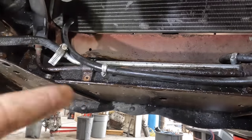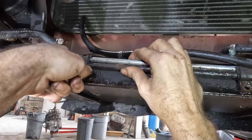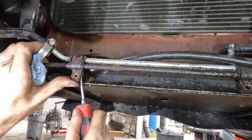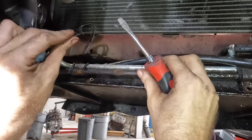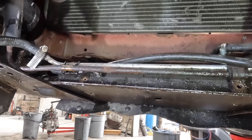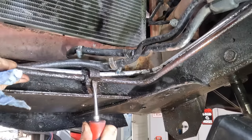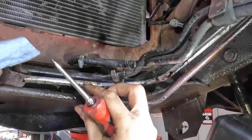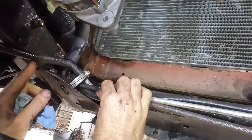Good thing I have all those spare bolts from the Miata. Now that the bracket bolts are out, let's separate these mounts and peel this line out of here. I might need a screwdriver — a pry driver. This is just a metal strap that wraps around these lines with a rubber bushing inside, which is turning into dust as we speak. There's one bracket — the other one is right over here. Those little rubber bushing things are turning into dust; I'll have to stick some rubber hose over the lines to create a bushing. Let's go ahead and fish this line down and out.